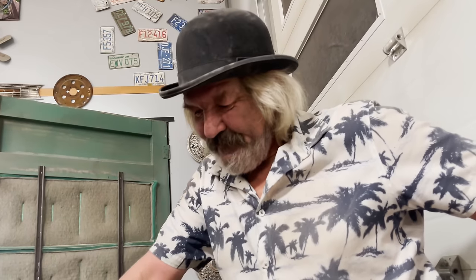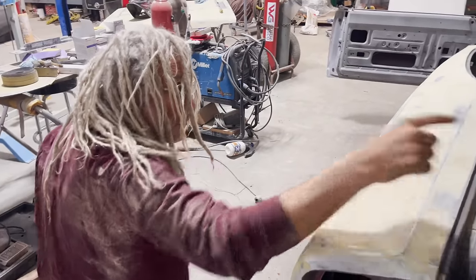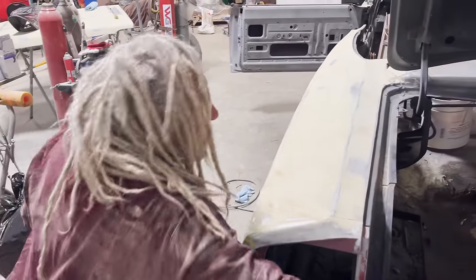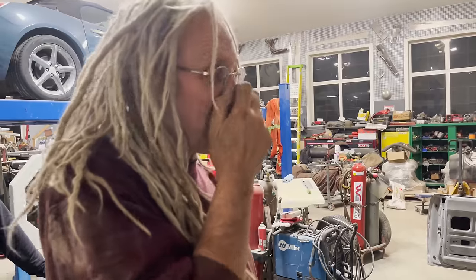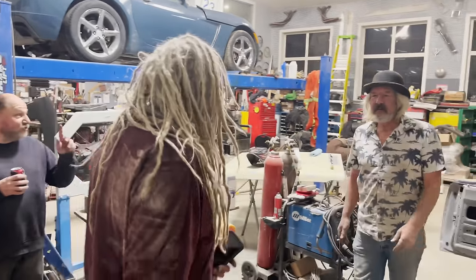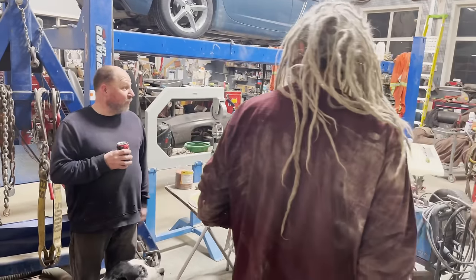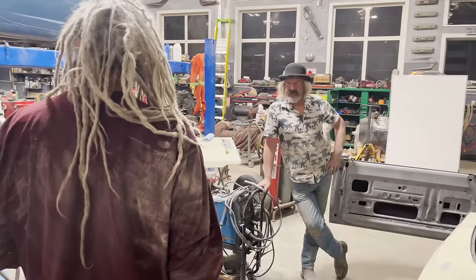Right, the motor twists this way, Blair. So all the torque on the car goes this way. So those springs on the big block cars are heavier. Doesn't change how I put a quarter panel on, does it? No, but it changes the springs you gotta buy. When you're honking on 500 horse going this way, the drive shaft... GM doesn't do that. Oh, GM offsets the motor. You look at a Corvette, the motor is offset to one side, to the right side, by an inch and a half. Yep. I knew that.